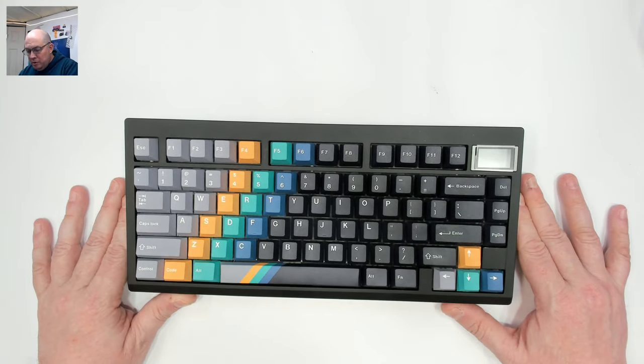But today I'm going to go ahead and show how to do it without having to open it up, in case you don't want to take a chance. I know people are afraid of breaking clips. If it's done properly, you should be able to open it and close it hundreds of times without breaking it. Screws into plastic is what bothers me, because after a few times of unscrewing and screwing, the metal screw wears away at the plastic post and no longer has any thread, nothing to grab onto. So in my opinion, I prefer clips. I know sometimes they can be hard to get into, but the harder to get into, that means the sturdier they are, as far as not breaking open and just falling apart.